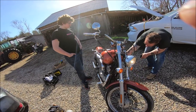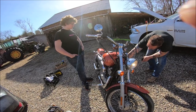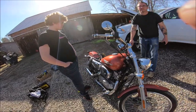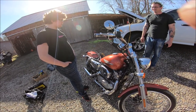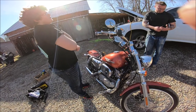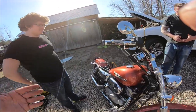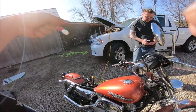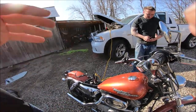It's going to need an idle adjustment — we don't have to take the carb off for that one, that's nice. Just let it run for a minute. That sounds 100% better. We'll let it warm up a bit. When it's cold the idle isn't there yet, so when you go like that you flood it. Plus the carb probably still has a little bit of stuff in there.